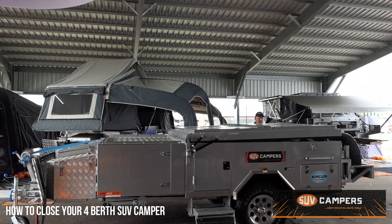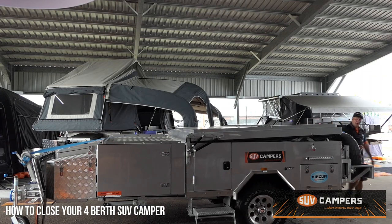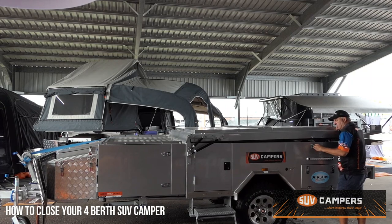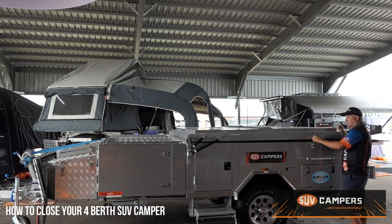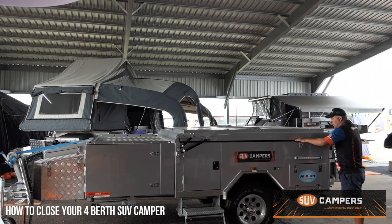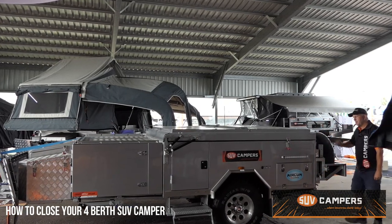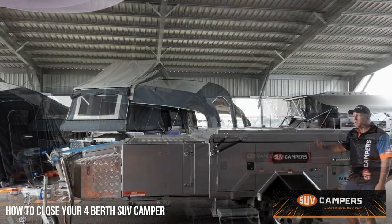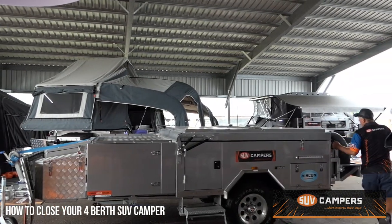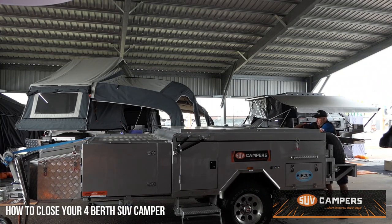Once you've got all the canvas inside, you can either winch it down a little bit more from the front or just pull it down until you get your over-center latch on here. Use that as a lever to put the back one on and simply pull down both levers at the same time. Same on the other side, and that's it. Once your lid is down and your over-center latch is securing the trailer lid, you simply take off your winch cable.